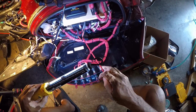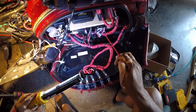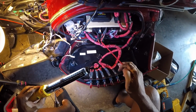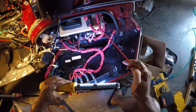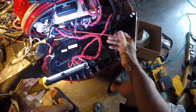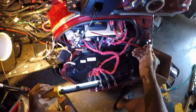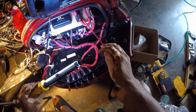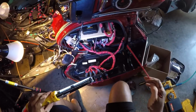So the first shelf is basically holding the primary battery, secondary battery, along with all my power sources for my lights. Each one of these boxes here are power sources for the lights, and then my second shelf is holding everything for the isolator and the fuse block. So it's basically three shelves in here. The bottom shelf is holding all the wires. Second shelf is holding the battery and all the power sources for the lights, and then the third shelf is holding the isolator, the inline fuse, everything else to make this dual battery setup complete.